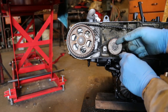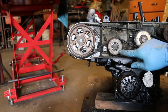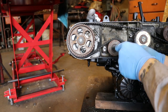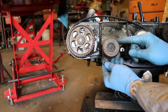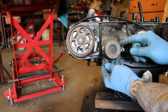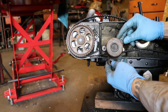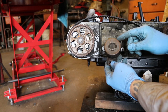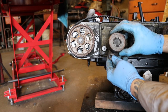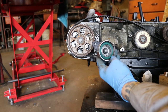And I'm going to take this off completely because I'm going to replace this bearing while I'm in here as well. You can no longer buy these idler bearings from the factory or anywhere in the aftermarket for this engine. So the solution is we have to adapt bearings from another vehicle. And I'll have a link to the video explaining how to do that in the description of this video. The end result is this bearing here.